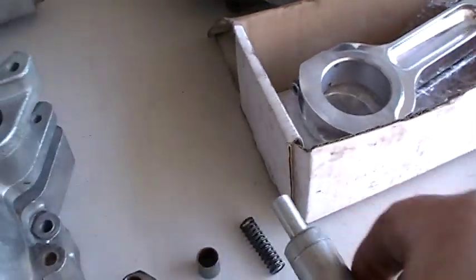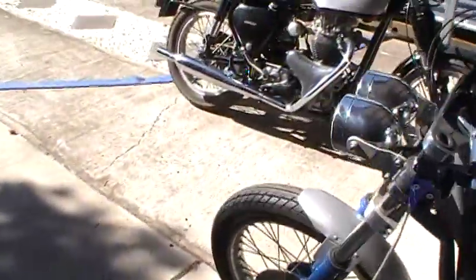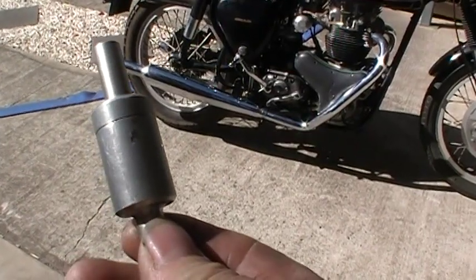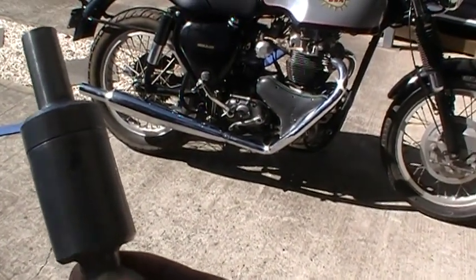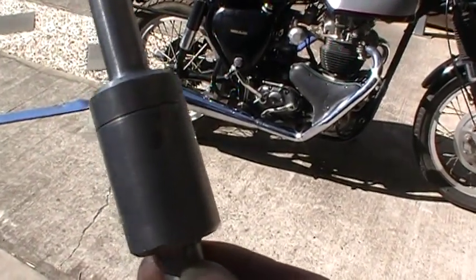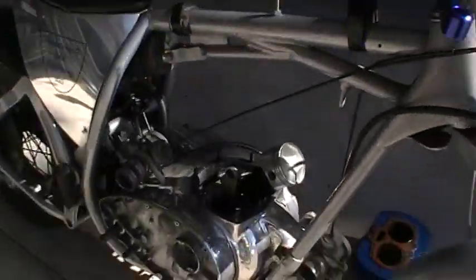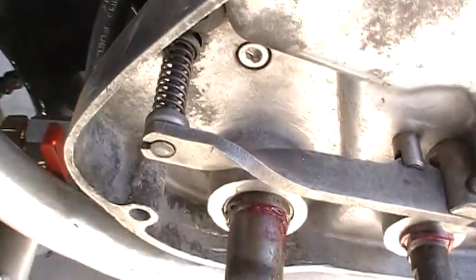The bike I just fired up has that oil pressure relief valve, and it's going to get one of these to stop the drain, like an anti-drain valve, vacuum operated, about 6 or 7 pound off pulls the ball off the seat, and in goes your oil. But I don't like doing that sort of thing, or like what this one's getting, which is a ball valve down in behind there. The other oil tank's got oil in it, it's got a little custom oil tank I had to make up in there.